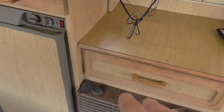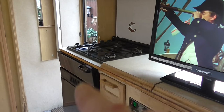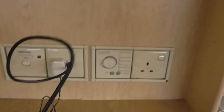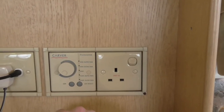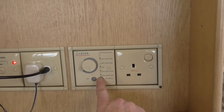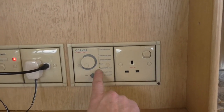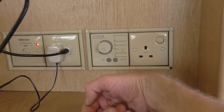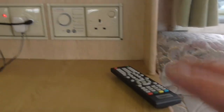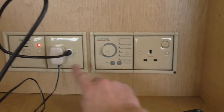With the appliances, if you don't use your van for a while, obviously the gas pressure might drop in your pipe. So when you come to light gas fires, cookers, and water heaters on gas, a few attempts to purge the gas back through. Now coming back to this here — behind that fire's fan, I'll turn that off. Now this is the fan master side of it. Unfortunately it doesn't work — sometimes it works, sometimes it doesn't. It's very temperamental. Just to make you aware.